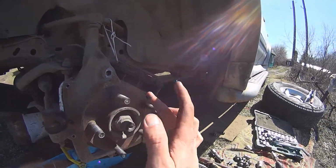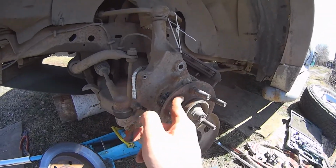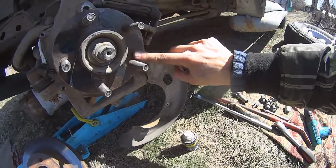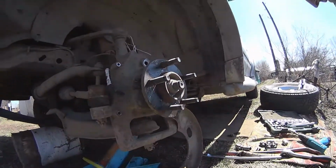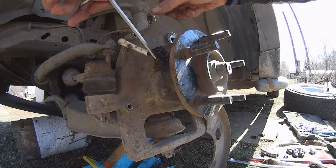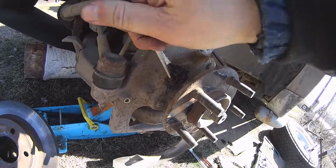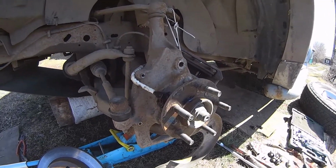And this grease that's left can go here like this. So the rotor will not get stuck when we're gonna pull it off next time. Like this. Just don't grease them threads. How it was here, like this. Never too much grease. When the hub is gonna get hot, grease gonna find the place to go. And your brake hub assembly gonna last almost forever.